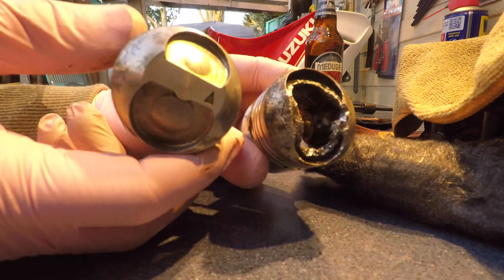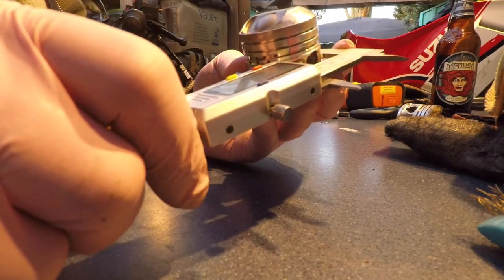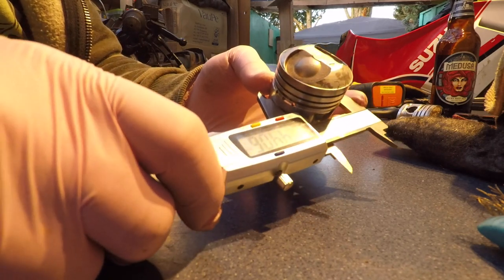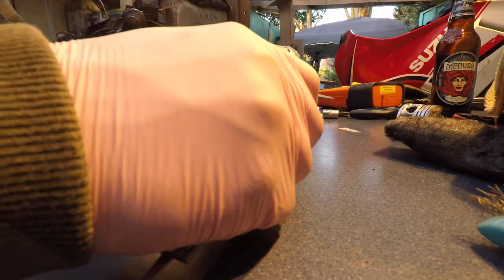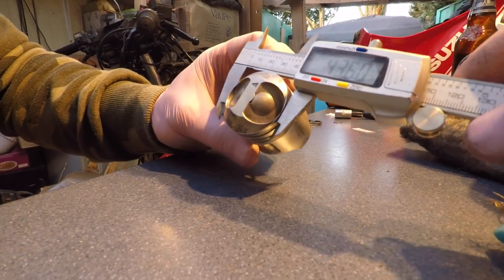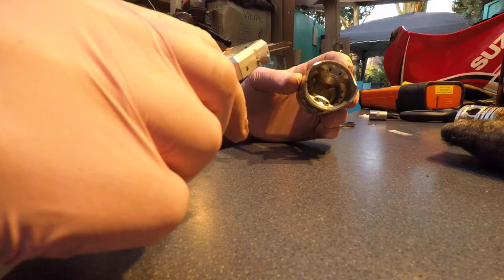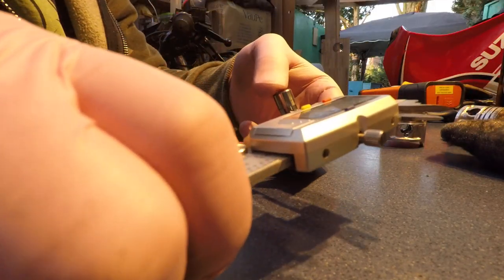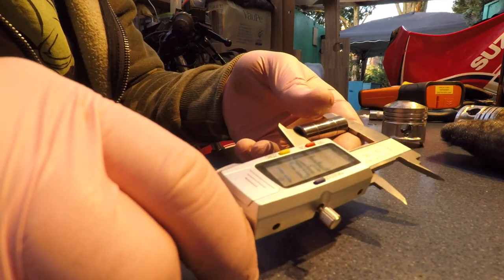Good piston. Chernobyl. The diameter of this piston is 44.6 millimeters — that's the diameter where the shaft is. The diameter where the rings are is 43.6 millimeters. The total height of it is somewhere around 49.77 millimeters. The shaft's diameter is exactly 12 millimeters and the length of it is 34.01.